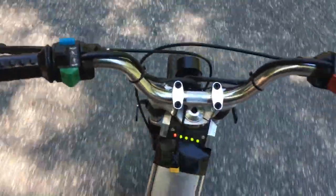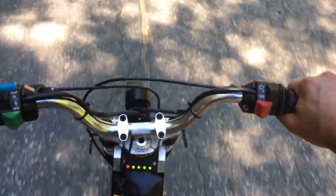You can just jump right over this bike and push it forward and start going. I had to reset the on/off switch because I left the bike on — it has an auto-off feature, which is sometimes awesome but sometimes not so good. In Worcester where I work, I was at a light right before a main rotary and the bike shut off because the light was so long. I had to recycle the power switch to reactivate it. So I suggest if you're at a long stop light, just pulse the throttle every 10 or 15 seconds so the motor makes an activation and it'll reset that counter so you don't get caught with it shutting off.